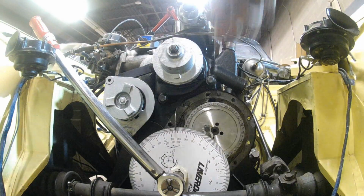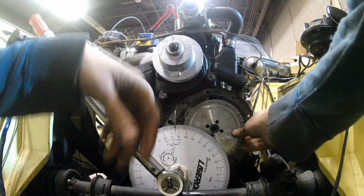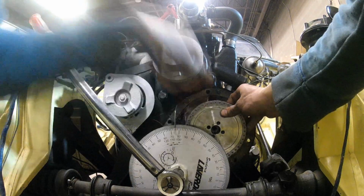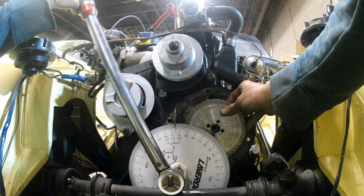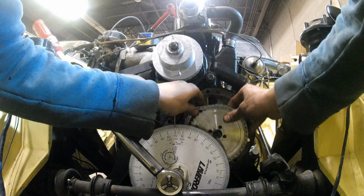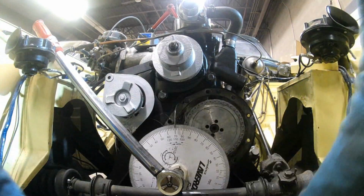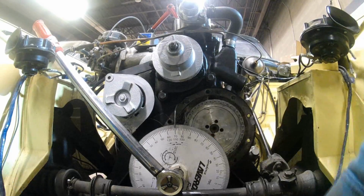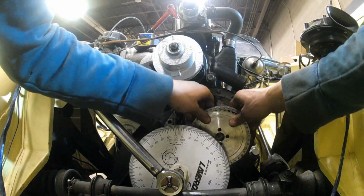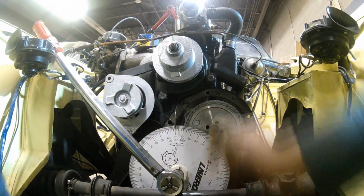So in this position now, because I approached the point of the camshaft in the clockwise direction, I knew that the cam was in the right position, so I just had to turn the crank to the 110 point and put the chain on again. Of course now the gear didn't fit the holes again, so I had to do the whole exercise with turning it 90 degrees, backside to the front, and finally I put it in the right position.